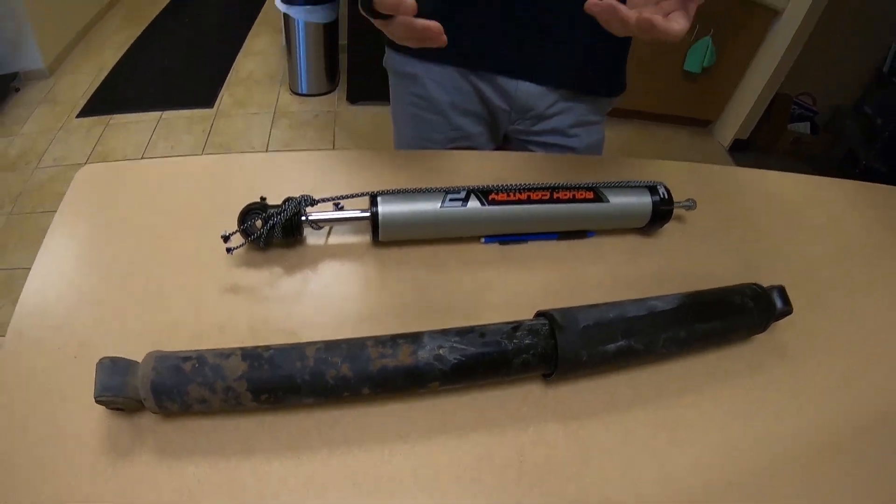What are the drawbacks? Well, since you have gas contacting the fluid — much like I explained in the Vertex shock video — you're basically going to have the gas and fluid combined under heavy service. The fluid basically foams up like root beer in that bottle that you forgot about for the last 150 miles. This makes the shock not do its job, and your truck is going to end up twerking at the end of a long day of off-roading.